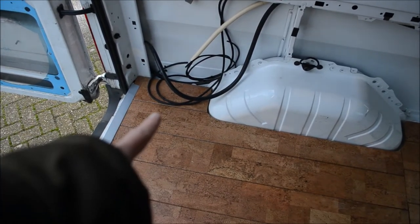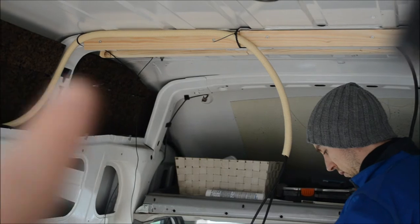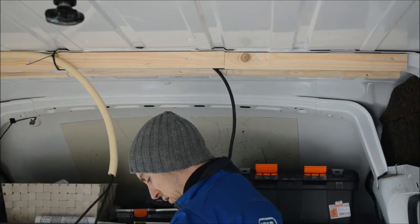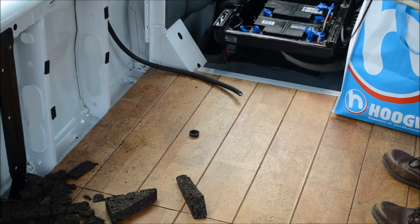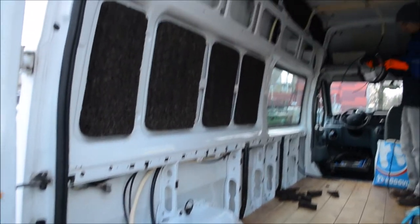It's now the next day. Yesterday we mainly worked on the paneling, and afterwards Jordi also worked on the wiring — he ran some cables down the van. Since the batteries will be installed down here, all the cables are wired to that point. Some of them are wired all the way along to the front of the van. The cables on the left are used for the fan, that cable over there is for some LED lights, and there's also one cable down there for the fridge. Jordi is now working on the cable for the solar panels.